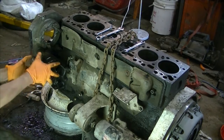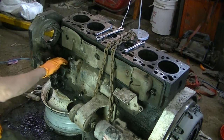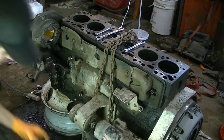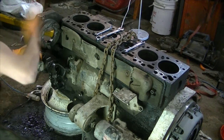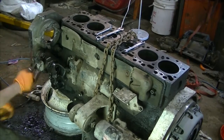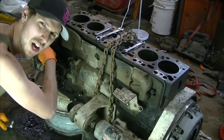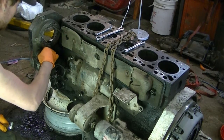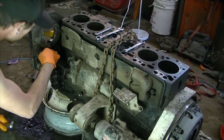You've got two 15mm nuts here that'll take off the entire assembly, or two 13mm nuts there which just takes off the back half. I don't need the entire assembly on there, so I'm going to remove it via the 15mm nuts. And they siliconed this one on too - I don't know why.